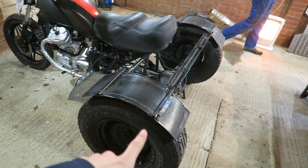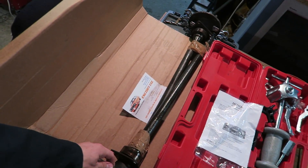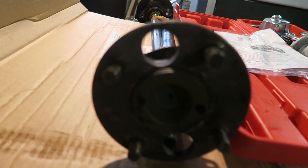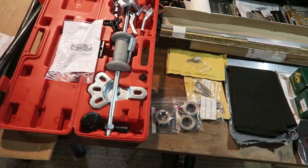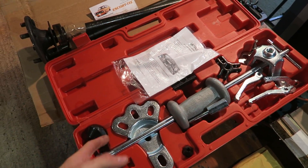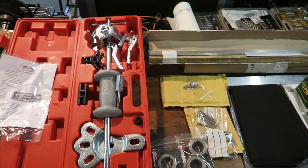We're just going to take today as we come, as we usually do. The first thing I think we're going to tackle today is the axles. As you guys probably remember, the axle seals need replacing and also we have a new hub for this side because of the dodgy stud. We have managed to source some new axles - these are for a Ford Escort or Ford Capri. We managed to find them and they've got bearings on them already, but we also picked up some brand new seals. The seals are going to need to be replaced using this slide hammer with a bunch of different attachments.